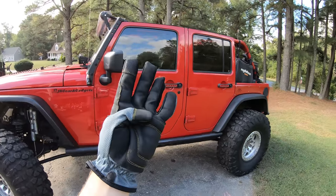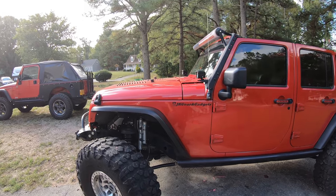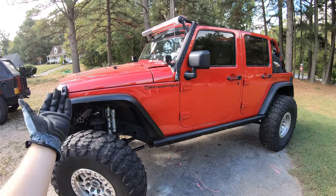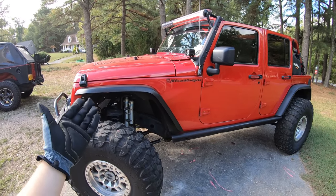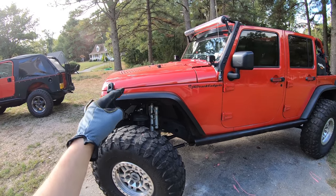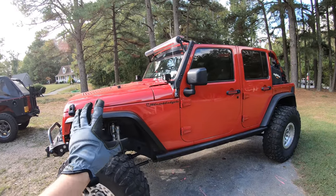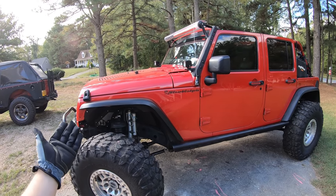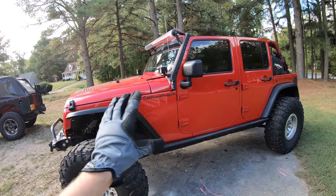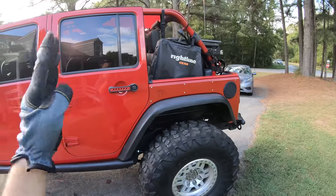What's the difference between a three-link and a four-link? It's exactly what it sounds like — one less link. The three-link has two lowers and one single upper. I'm doing that for the front and rear of this Jeep. Some people say they don't like the way three-links ride, but I personally like it — especially off-road, we get a lot of articulation without worrying about that other upper link binding. The only con is relying on a single upper link, but if we build it strong enough we don't need to worry.